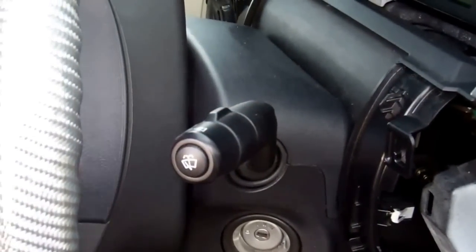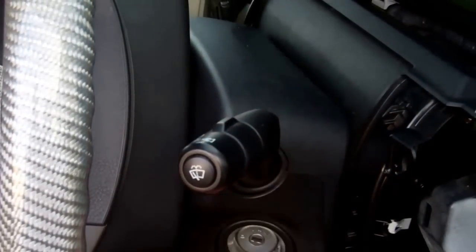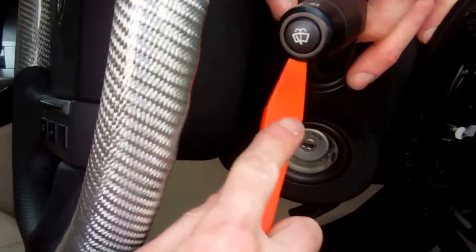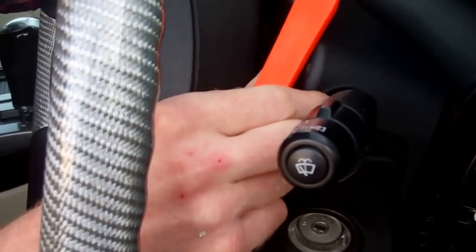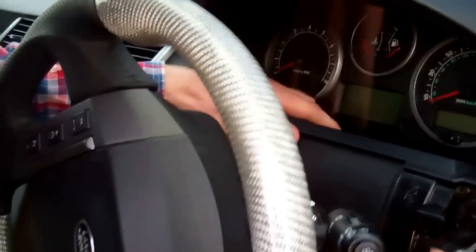The workshop manual incidentally tells you you've got to take your airbag off, your steering wheel off, and drop the steering column. So this is the sort of unofficial way. Should we get the plastic tool in there? We need to just lever off this and separate these two. We scoop it out and around like that - you can just wiggle that. This literally just clamps together - these are the receptacles and the spring bits are on the other half of the assembly. Tom's already had this apart once and put it all back together and nothing broke during the process, so we're fairly confident this is the best way.